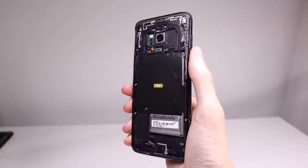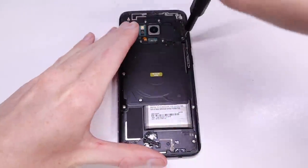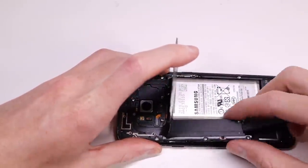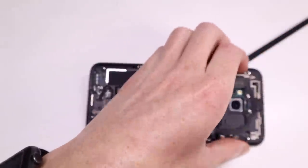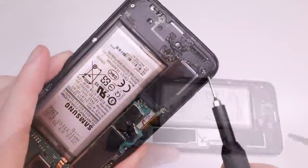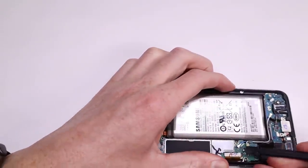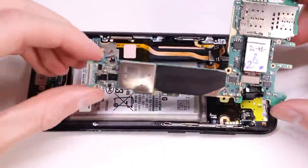You can see how different this looks compared to an iPhone. The repair itself is actually quite simple once you get that back panel off — there's only a small number of screws on the back which you need to remove, giving you full access to just about everything in the phone. The part I'm currently unscrewing is the wireless charging section, which also contains the battery temperature sensor. If you remove this plate and then try to charge the phone it won't work unless you put this plate back in. Once you remove that plate you get full access to the phone and can first disconnect the battery to avoid any damage. After that you can start to disassemble everything. One of the biggest differences I noticed is there are no brackets screwed on top of the connectors like in an iPhone, and once you unplug them the board isn't even screwed in — it just falls right out.